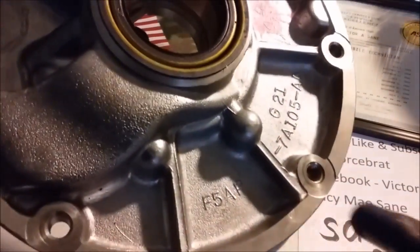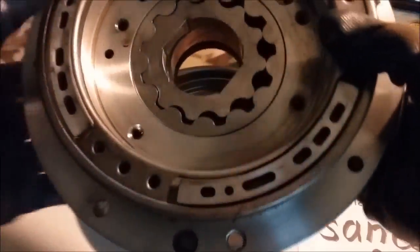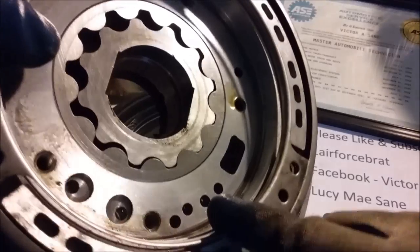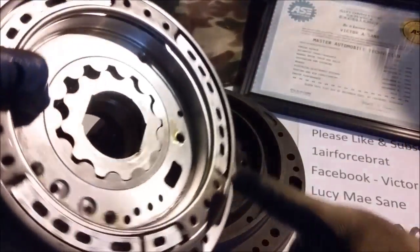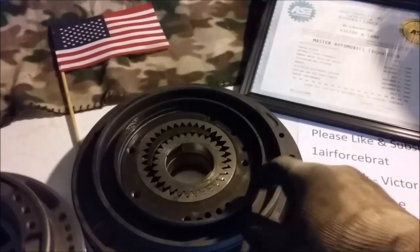This is the 1995 and up pump. Like I said, it looks just like the earlier aluminum pump, but it is not interchangeable with the cast iron pump, and it's not interchangeable with the 1992 to 1994 aluminum pump. If you look at the cast iron pumps you'll see four holes right there, and in the 1995 and later pumps you see those same four feed holes plus an additional two feed holes here. The piston and retainer are still the same, although you don't see one here — it looks just like it.